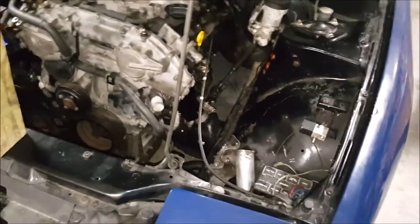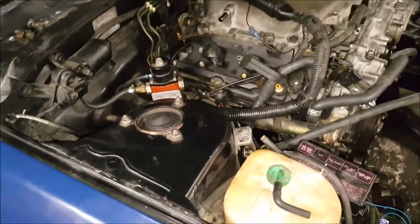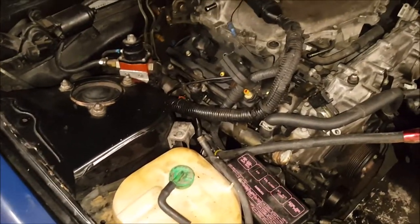At least it's a pretty decent location. I just didn't get a six-speed decal — I'll leave it so people think it's a five speed. Besides that she looks good, it's just a matter of cleaning up. I gotta figure out new routes for my fuel lines. I'll do a half-inch line — especially with the exhaust being on this side and how the stock fuel lines come here, I'm just gonna do hard lines and get that squared away because I don't want to deal with any crazy issues.